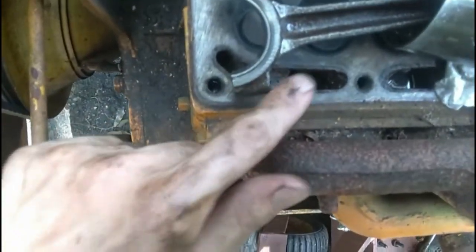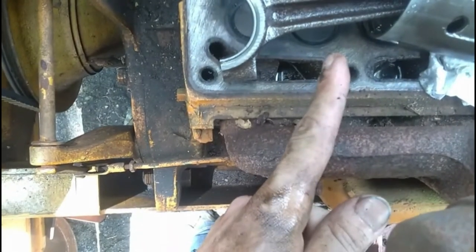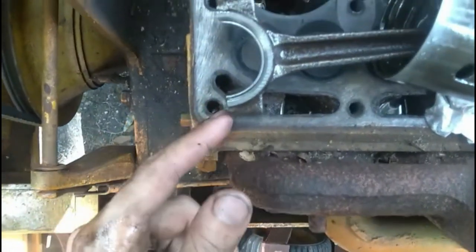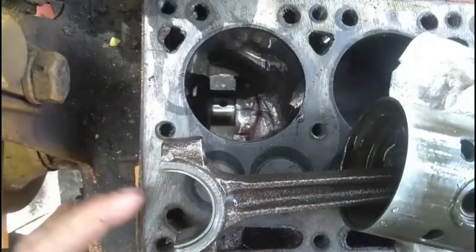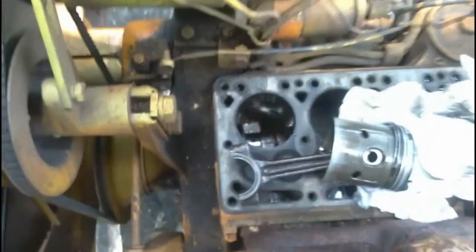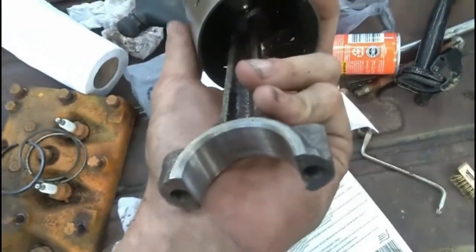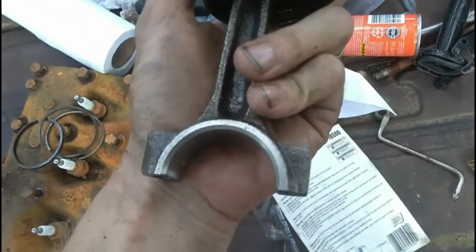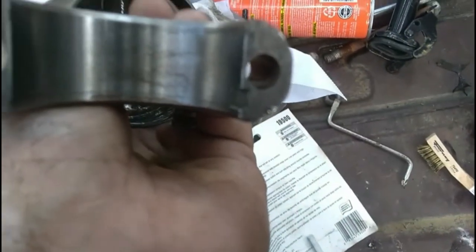And that's where taking the bolts out, if you can get them out all the way, which they come out and they're, you know, yay tall when they come out. If you can get them out all the way, it's important, because the thread scraping against the crank journal can gouge it up. So to take the rings off, yeah, I got this out. I took that bearing out of there so that I don't drop it. And you see it has a little index tab too, which if you're lucky, yours will.